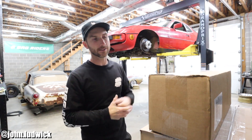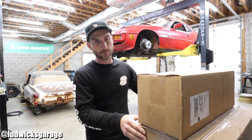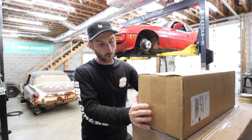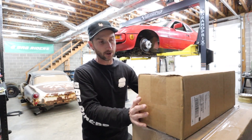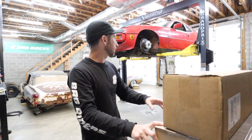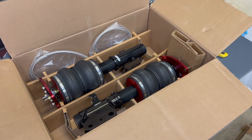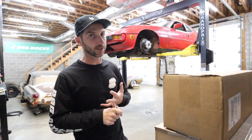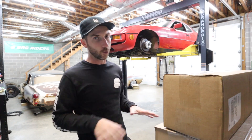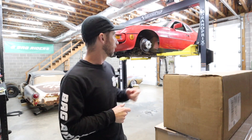Welcome back to the channel. We are still pushing forward on the Porsche 944S and the air suspension I'm putting together for that car. The management finally showed up yesterday from Bag Riders. I'm going to walk you guys through what I'm going to be running for management in this car. We're going to unbox everything very shortly, but to get you guys up to speed, all the hardware is in the car. We've got the Subaru front dual bellow strut bags from AirLift — we had to redrill and cut a few things on the strut assemblies but no welding required and no modifications to the Porsche body was required either.